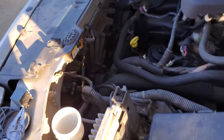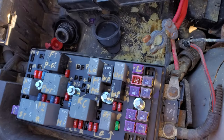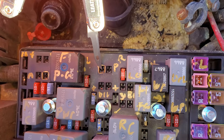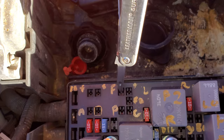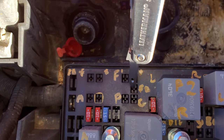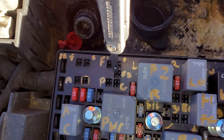The other wire on that circuit is a white wire. During low speed mode, that white wire is not grounded to a solid ground — it is instead sent to fan number two. So that white wire is connected to this pin right here. Sorry, wrong relay. That white wire from fan number one is connected to this pin right there. And normally when this relay is not energized, the relay is making a connection from this pin to that pin. That pin hooks up to the right fan on the gray wire, so the gray wire is actually receiving voltage through that fan number one.